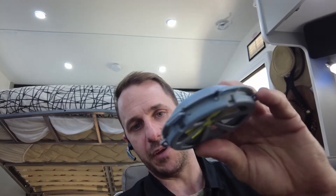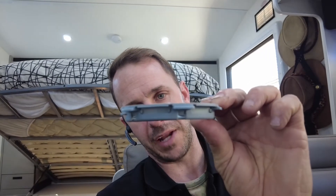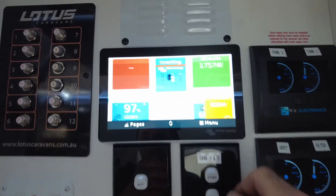Very accurate - much better than those differential pressure sensors we've been getting around with for years. It comes with a full fitting kit. You get a little activator - you clean the bottom of your tank, put that in place, then position the sensor up with a bit of jelly that it comes with, straight up under your tank, and set and forget. I've been running one since they came out. If you're really concerned about stone damage, put a little guard or removable panel over it. For people with stone guards and bash plates under your tank, you need to do a cutout, but make it removable so you still gain access.